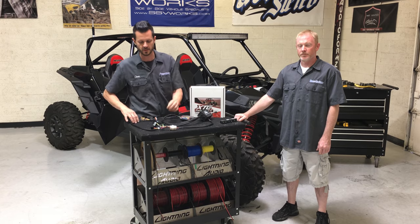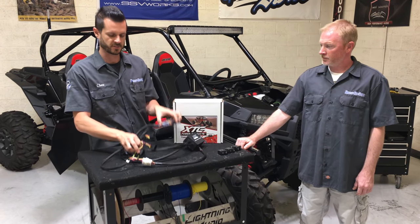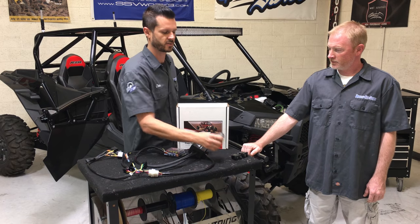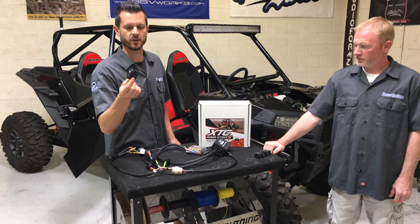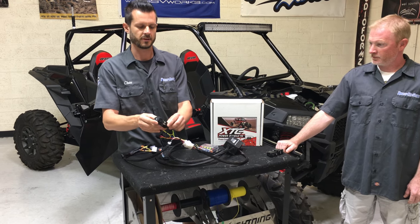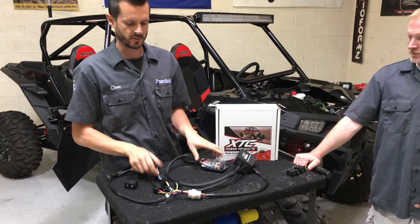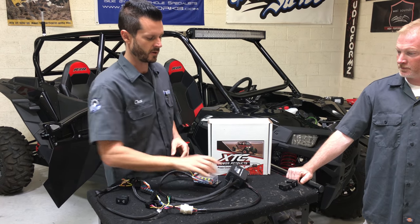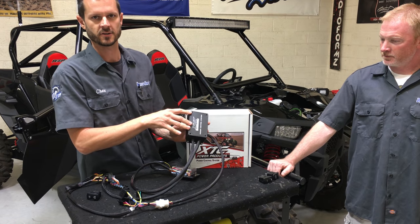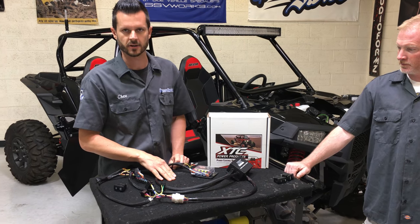It's basically a way to run six circuits in your vehicle. The whole system is self-contained, real easy to install, easy to use. It works with five-pin Carling rocker switches — they plug directly into these connectors here. Everything's fused, you got all your outputs, and you get four high-current relays built in so you can run light bars, lighting, and other high-current accessories.